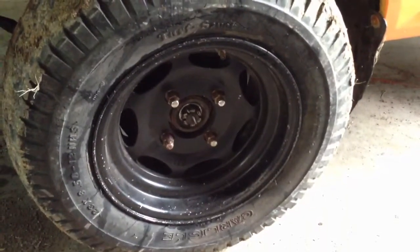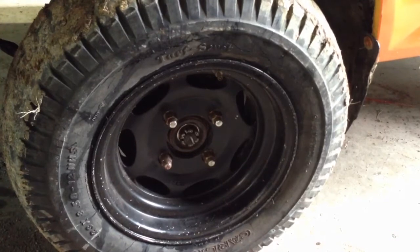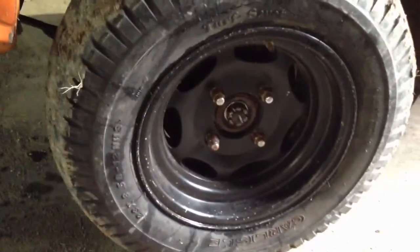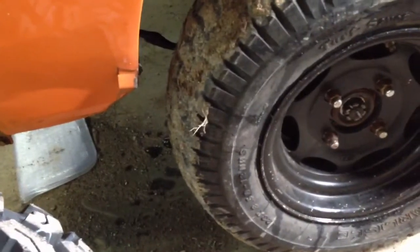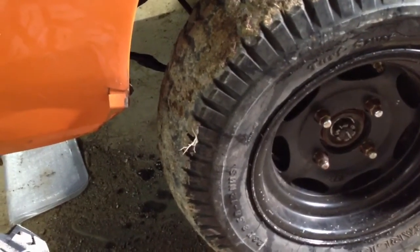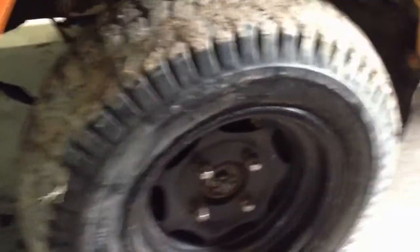So I ordered some four-wheeler rims — 12-inch rims, 6 inches wide, with a 5-2 offset, meaning 2 inches sticking out and 5 inches in. They fit these tires perfectly. I've got about an inch and a half clearance, so there should be no problem running these tires on that same offset. The other rim is a 6-inch rim with a 5-1 offset, so it'll be 5 on the inset — they won't stick out quite as far but will have about the same inset.